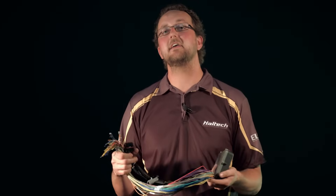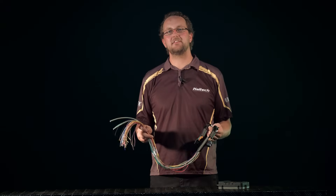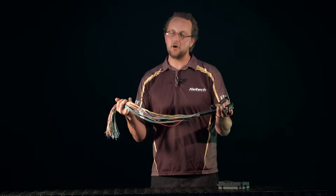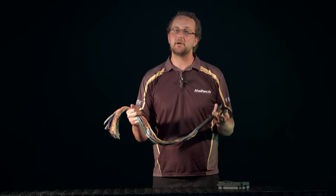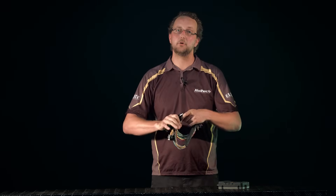That's known as a short wiring harness installation method — nice and simple, utilizing the factory wiring harness. It's really important that your factory wiring harness is in good condition if you're going to use this method. If the factory wiring harness in your car is already looking a little ragged or like a bird's nest, it's not the best idea to wire in a brand new short harness and rely on the connections in your factory loom.